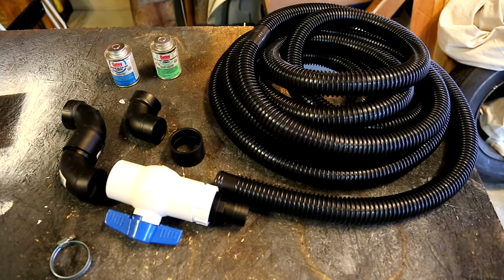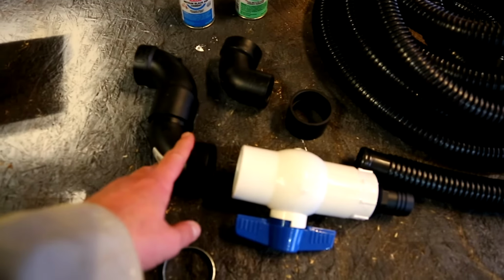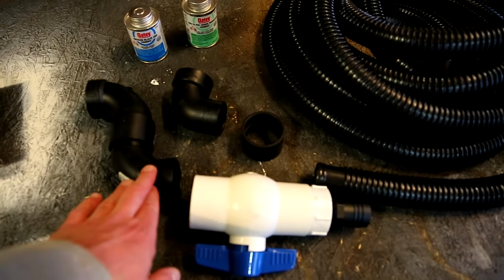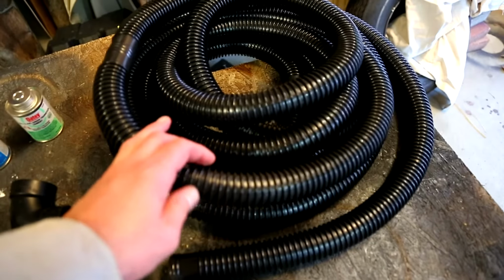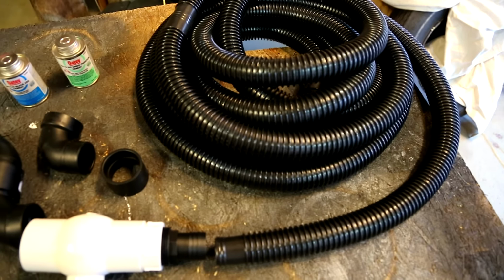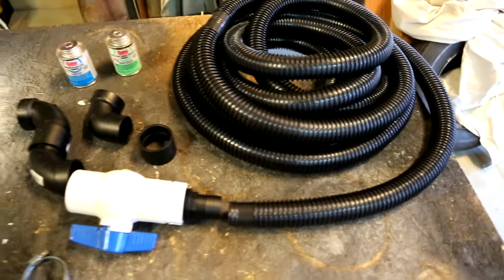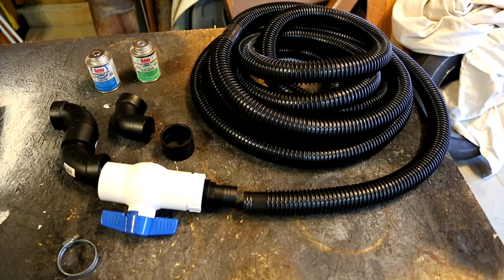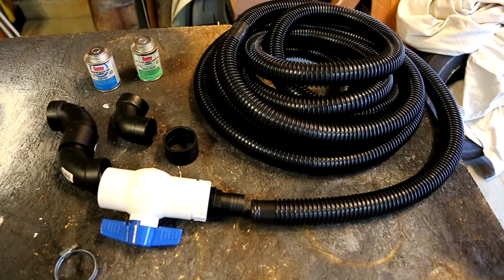Okay, so here's the gray water tank assembly that I'm going to try to rebuild. I have the ABS pipe that comes out of the remaining pipe that's underneath the trailer. I kind of MacGyvered that to go into a valve so that I could stop the water flow. It's PVC, they didn't have one for ABS. And I found this little kit, this pump. It's for a sump pump drain. But I found that I could attach it in here, and then I can store that in the camper, so when I go to empty my gray water, I'm not just pouring it out on the ground. I can actually put it in the disposal system at the campgrounds. And of course, I've got the glue that I need for the various pieces. So we're going to put all this together, see if I can get the gray water piping to be complete and functioning so that we don't run around with our gray water spilling out of our tank.